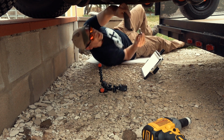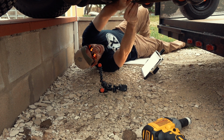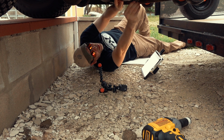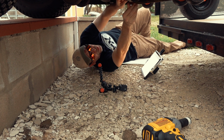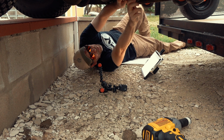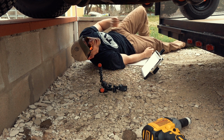The manual says to torque them down to between 90 and 110 foot-pounds. I will for sure give that a try, but I think if I use a torque wrench, I will spin the blades instead of, well, torquing them down. So I have to hold them in place somehow. When I took them off, that was not a problem because the impact wrench doesn't really spin a lot. I mean, it uses a lot of force, but without spinning them really. I'm not sure if I'm explaining this right, but it for sure worked without. The impact wrench was able to break them loose without spinning the blades, that is. It spun the bolt for sure. Okay, second one in place.